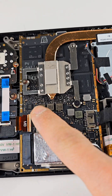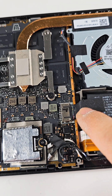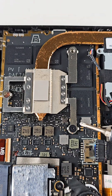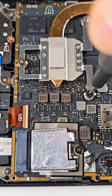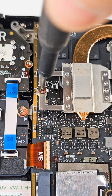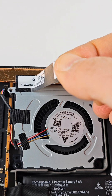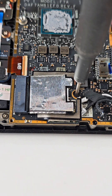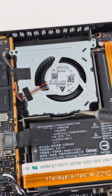If you can see guys, this is the board — I need to take it out. First, I need to disconnect the battery. Just be careful. I have two more screws: one here and one here — these are for the heat sink. I will also disconnect the fan.